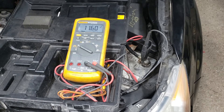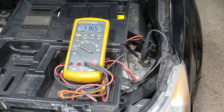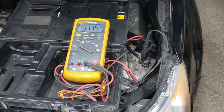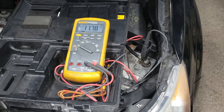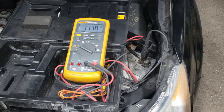As long as your alternator continues charging at operating temperature between 13.5 volts and 14.5 volts, you are good to go. Sometimes when your battery is complete crap like mine, you'll see it spike a little bit higher than 14.5 volts — that's not generally a problem, but if it's anything higher than 15 volts and your battery itself isn't charging, either your alternator could be faulty or your battery is completely crap and needs to be replaced. There are certain systems and cars that charge on the higher end and certain ones on the lower end, so you may need to look up the specifics for your car, but for this one and the majority of vehicles out there, 13.5 to 14.5 volts.